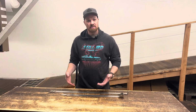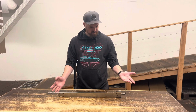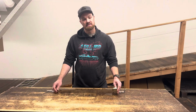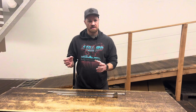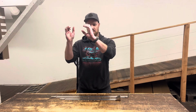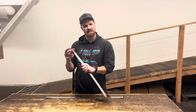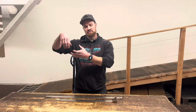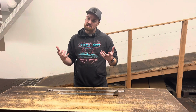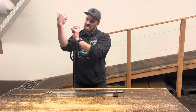And then you don't have to worry about them rusting, corroding. So one thing you'll note is that when you remove the factory tank straps, you somewhat have to bend them out of the way to twist them out of where they're keyed in the back on this end. Normally you would drop them, they would hang, then you would drop the tank, then you would pull the straps out. But if you don't really want to pull the tank, you don't actually have to. You just have to flex the straps out of the way and then pop them out.